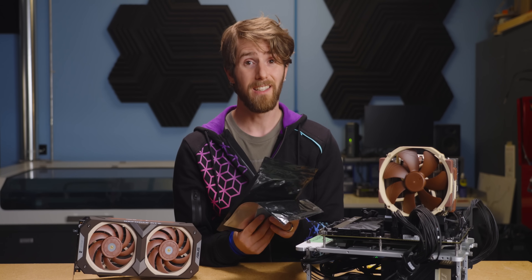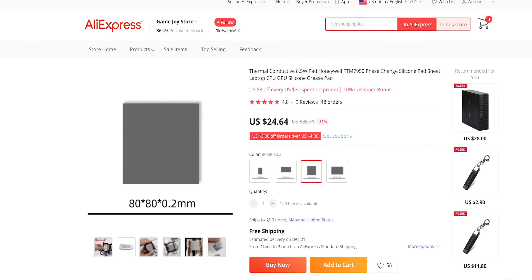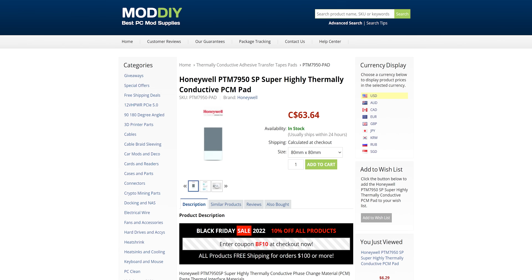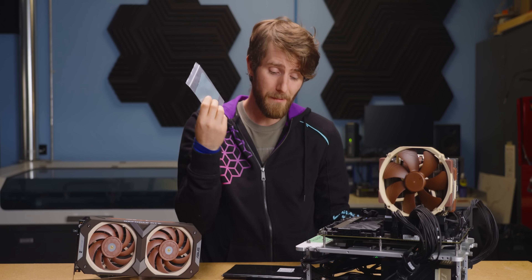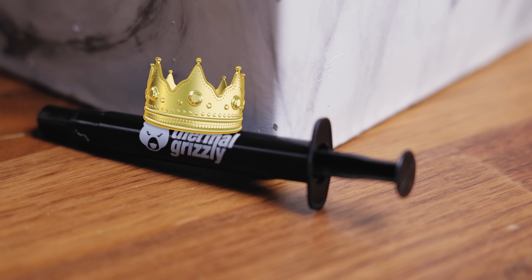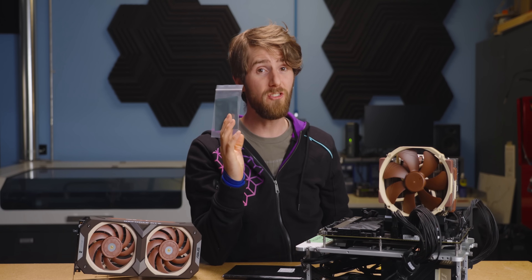But your mileage may vary, and if you guess wrong, it might be a pretty tough pill to swallow because, problem number the second: PTM7950 is not cheap. A single 8cm by 8cm pad like this one that might get you a handful of applications costs the same as a whole tube of NTH2 — or as much as three tubes if you want to take the safe route and go for a definitely authentic one from ModDIY. If you're after the ultimate in thermal performance, liquid metal is still the way to go, even if it's only by a hair. But if you want something that you can apply once and have almost peak-tier thermal results for the entire life of your device, well, maybe it's time for a phase-changing material like PTM7950.